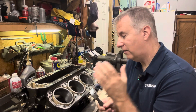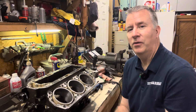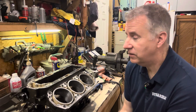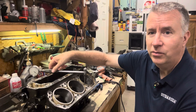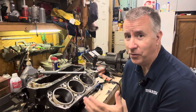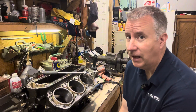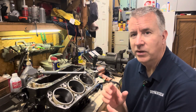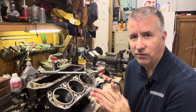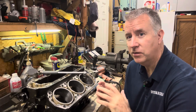When I was honing in that video I could feel it in my hands - this cylinder is out of round. This one is out of round, and this one is more drastic. Even the one we hoped we could reuse as standard is out of round. So now this is going to need six new pistons. They do make a 15-over, so I won't be doing too much grinding - I'm already three to four thousandths out of round, so I only need to go another eight or so to reach the piston wall clearance the book specifies: seven and a half to eight and a half thousandths.